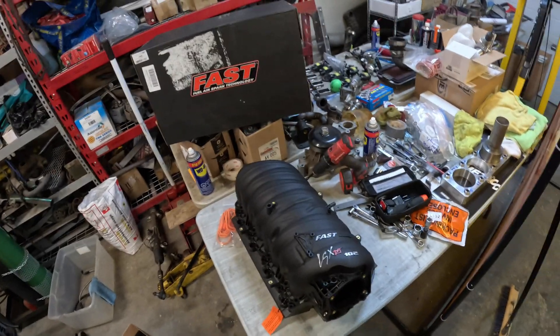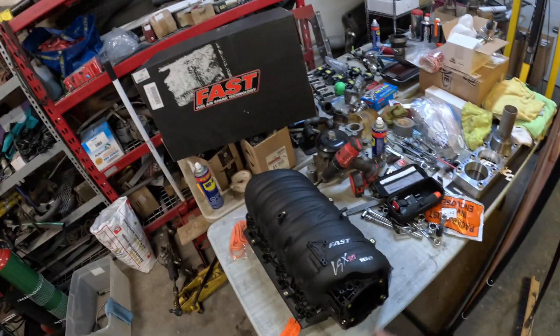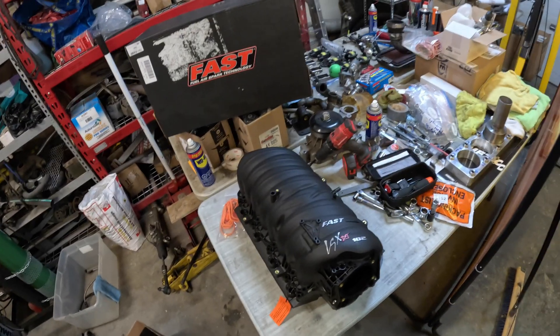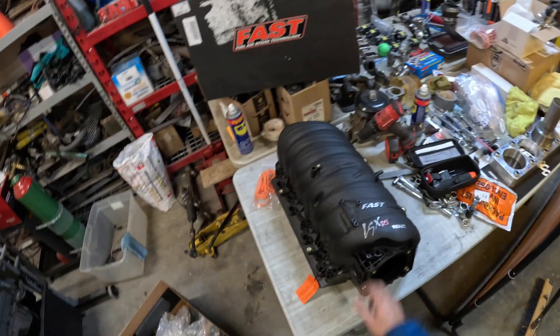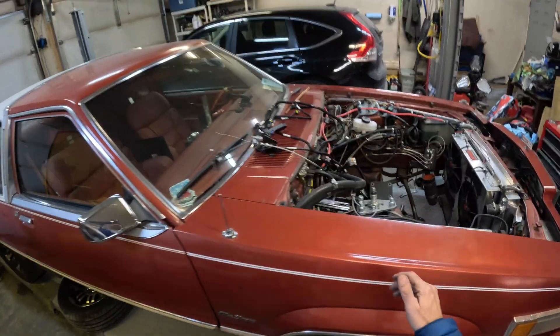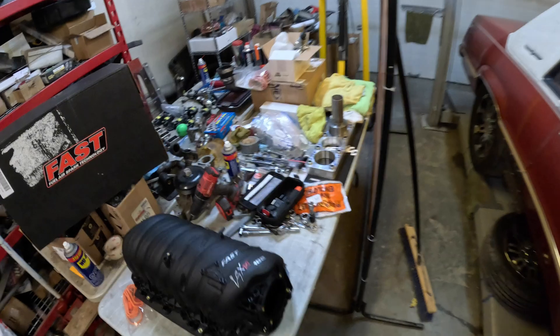These things make power basically from about 1,800 RPM. It's rated to 6,000, but when Holdner tested it, it was making peak power at 6,900, which is perfect. You can rev these things up there and still make wicked top-end power. The combination I have here will work perfectly because this is more of a low-RPM deal. I've only brought it up to about 5,800–5,900 just testing, and it pulled like crazy, so I didn't need the 8,000 RPM manifold.